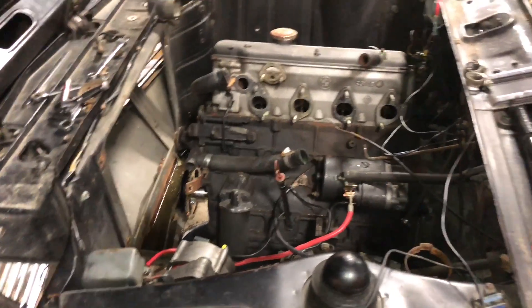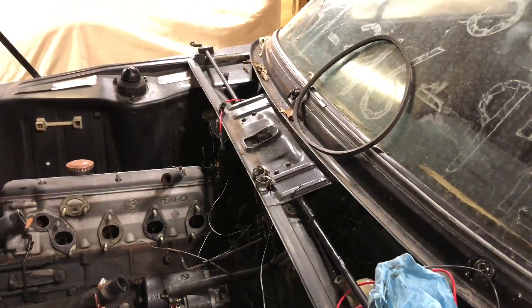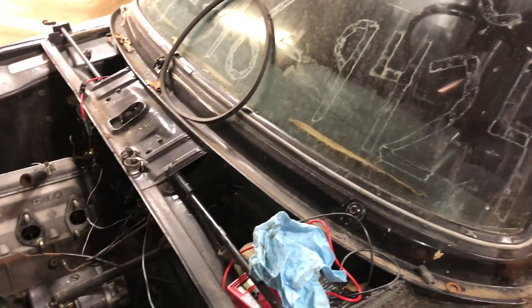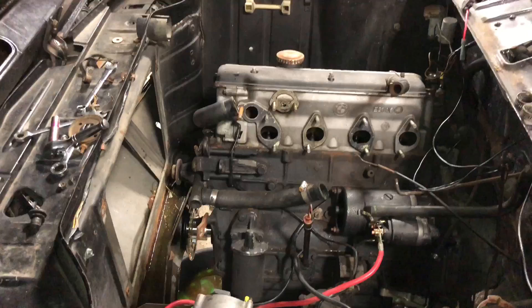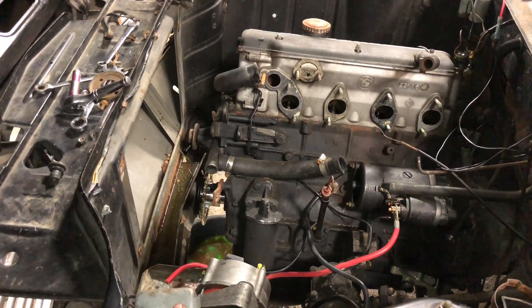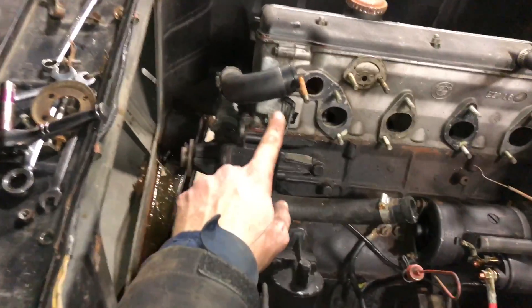I'm not really sure what of these relays are all six volt. All the bulbs I've checked in the car so far have been 12 volt already, but I'm guessing none of the interior electronics will function properly and are probably burned out from the 12-volt onslaught — unfortunately not really sure what to say there.